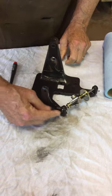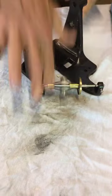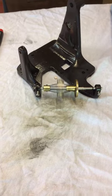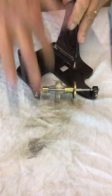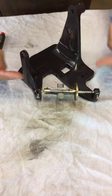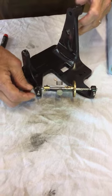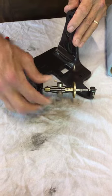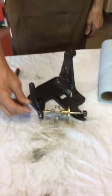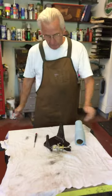So you lock this one down, and this little screw right here, you just back that off a little. And it runs. I'm going to spin it, and it comes to a stop when you lock that bearing. You don't want both bearings driving in — you want to have this a little loose. And it should just spin and spin and spin.